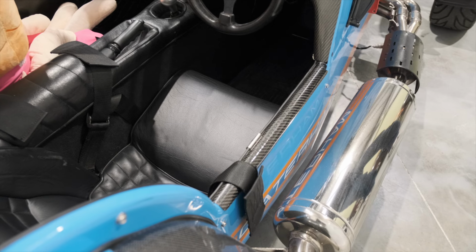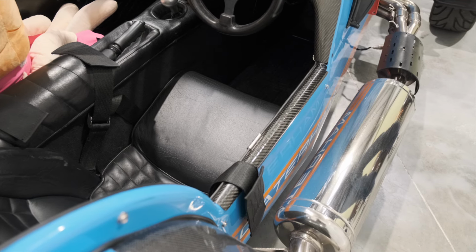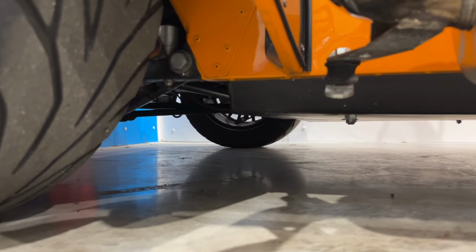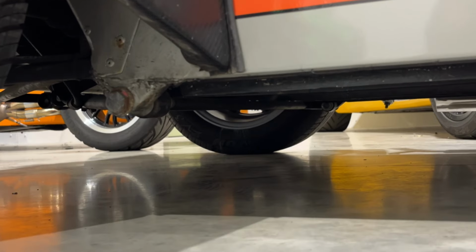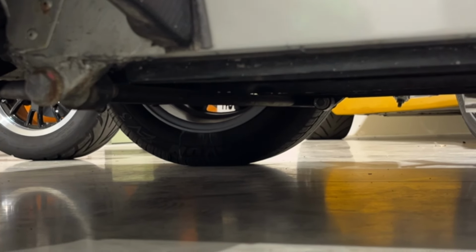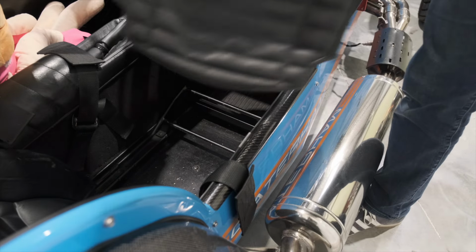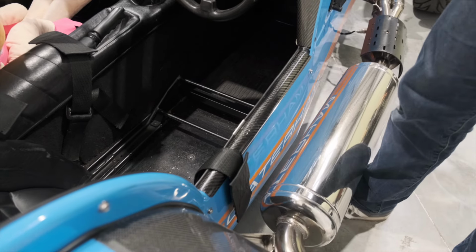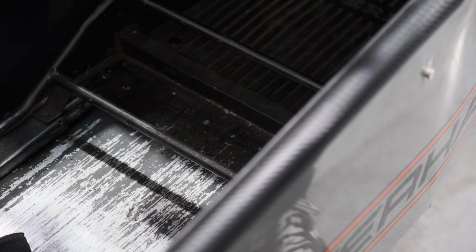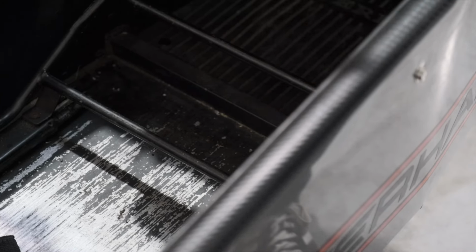There are two easy ways of identifying whether or not a Caterham has lowered floors. The first is simply to look under the sides. A lowered floor pan will be dished, where a standard floor pan will be flush against the bottom edge of the side skin. Alternatively, you can come into the cockpit. Just remove the base seat swab, assuming you have leather seats, and it will reveal the cross member that runs across the floor pan. On a standard floor, the floor pan itself will be flush with the bottom of this bar. With lowered floors, you'll be able to pass your hand through here.